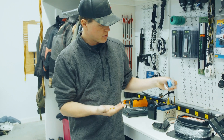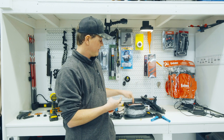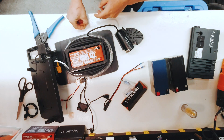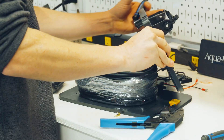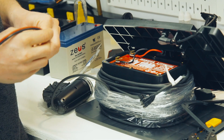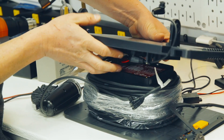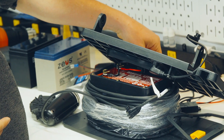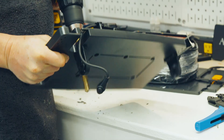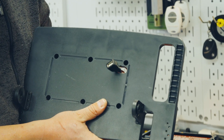So we're going to add these little piggyback devices — basically you slide them over your terminals and it allows you to attach a few more things. There are three things we need to attach to this battery: our new charging system, the AquaView power, and the USB. We're going to start by sliding these little connectors on and work from there. On one end we're going to connect the charging dongle; on the other end we're going to connect the USB. It's not super clean, but I want to make sure it's going to fit flat — there is a little clearance in there. The next step is drilling a hole where these cables can stick out — the charging cable and the USB. We're going to drill the hole from the backside to make sure we don't mess with anything else.